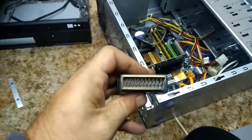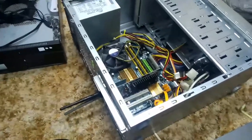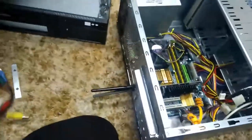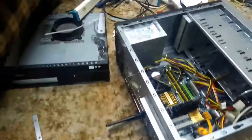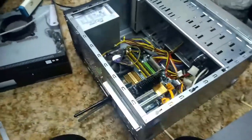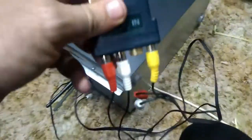Then we'll get some power leads, keyboard, mouse, and an RCA lead long enough to go. I'm going to use this reversible SCART, which will be alright, and we'll plug it into my rear projection television. So we now have audio and video into SCART. These SCART plugs are reversible - you need to have them going in to something, or coming out of an old school satellite box. Foxtel still use these here in Australia in some cases as well.